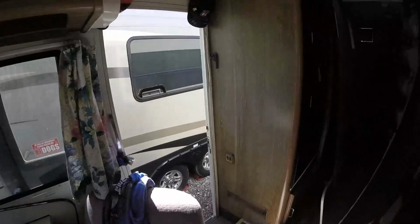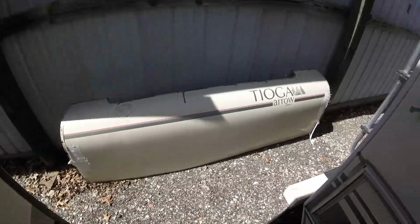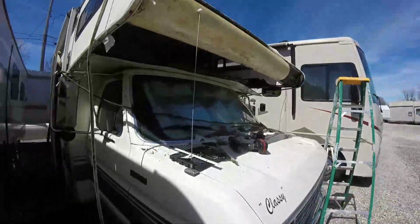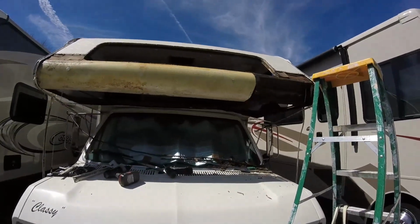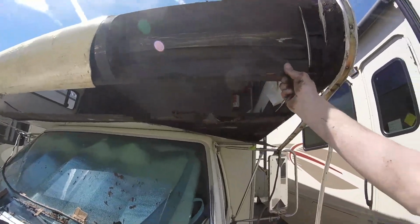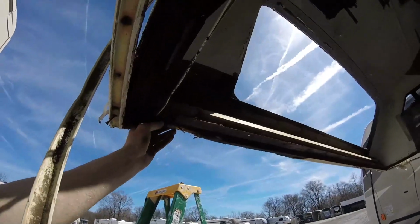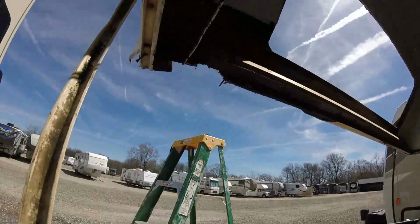But take a look at it from the outside. Lying back here is the piece of fiberglass that wraps above the windshield around the bottom of the camper shell. And here from outside, you can see getting her stripped right down to the bones, which unfortunately the bones are rotten. That's why I'm stripping it down so far. See, that's just crumbling. That's no good. That's no good at all. A view from here, from that window leaking, it has just destroyed the wooden framework.